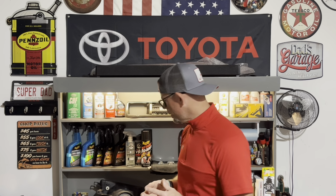So a little bit of my experience here. I went on to the DENSO website. I put in all of my appropriate information for my specific 4Runner, and it actually said that I needed two of the exact same part number. And that part number was this DENSO 234-4162. When you look at this on the website, one of the main key identifiers to this part number is that it contains a 10.5 inch wire length. And that's the wire that comes off of the O2 sensor, eventually making it to the electrical connection on your 4Runner.